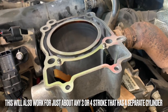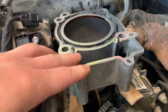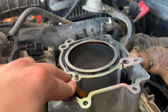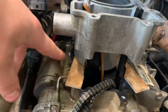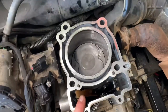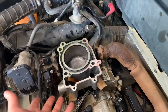So you're working on your Polaris — two-stroke, four-stroke, snowmobile, whatever it might be. This is a Polaris Ranger 570 motor, and the cylinder comes off the block, as you can see here. I've just replaced the top end, the piston, and everything. But compressing the rings — you can't use a traditional automotive ring compressor because you wouldn't be able to slide it off since it'd be captive.